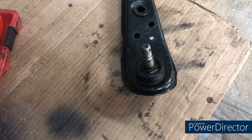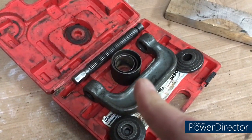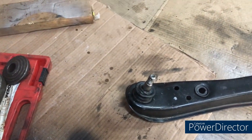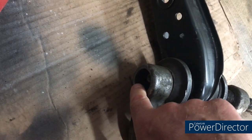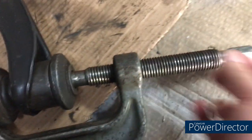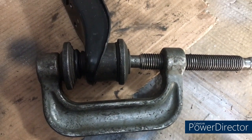We've got the circlip off and given it a quick clean-up because it was just greasy. We're ready to try and press this out now. This press tool is actually a rental — I don't own this, so I've gone and rented it. The setup: there's a fitting with a hole end that goes over the ball joint spindle, a tube where the ball joint should drop into, and a fitting on the end where the screw goes in. This should push it out.